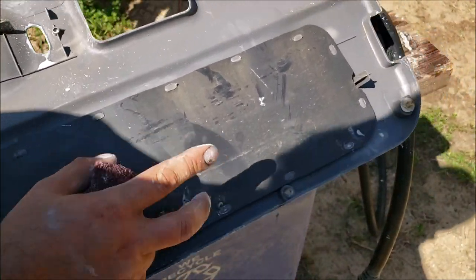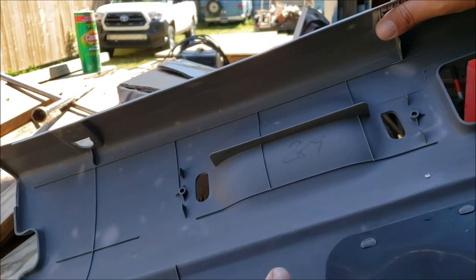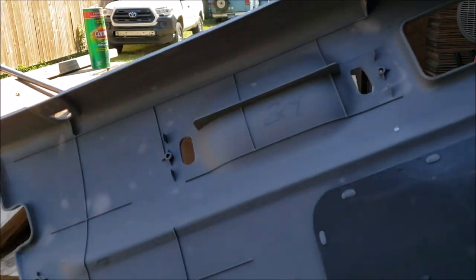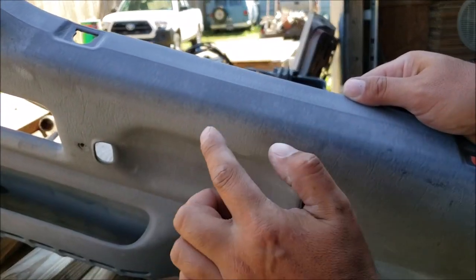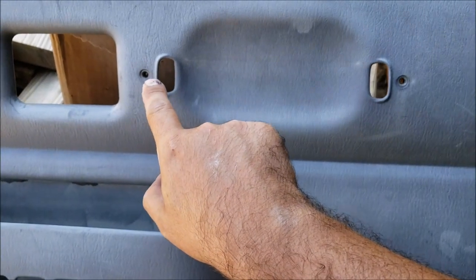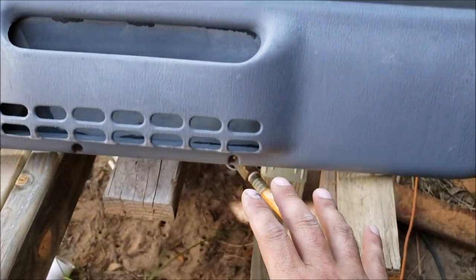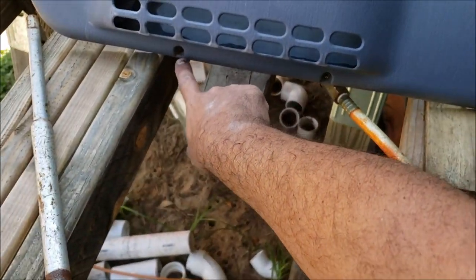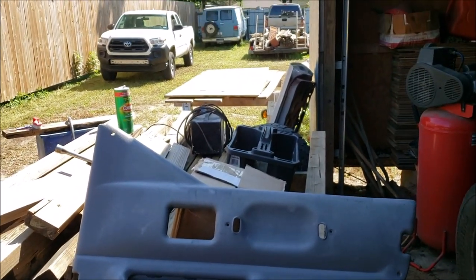We're going to thoroughly wash behind the door panel as well — all this dirt needs to come off. You want to wash the back really well because that's where you'll test the color and practice spraying if you've never sprayed before. When we used the scotch brite and polished that baked plastic, we took a lot of it away and it looks a lot better. We still need to get all the dirt 100% removed — inspect any places you missed, including rust in the screw holes. We're going to wash these thoroughly one more time with bleach soap.